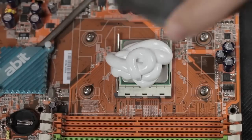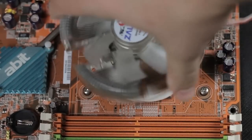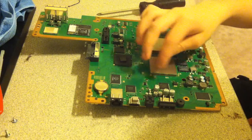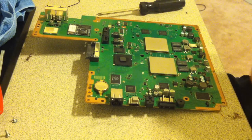Go ahead and get your CPU fan out. It doesn't matter if it's dirty, it's going right on that paste. Just squish it in there. Uh-oh. Oh, damn it. We got some on the orange. As you saw before, I got a pretty good amount. You don't need to get every inch of the whole chip. You just need to get the majority of the middle.